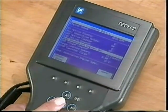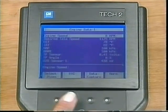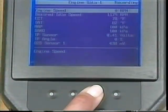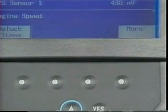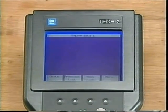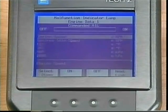To go an entire page forward or backward, use the arrow keys — the left arrow takes you back a page, and the right arrow moves you a page forward. Data Display also features several important soft keys. The DTC soft key takes you right into viewing related DTCs. The Data Capture soft key lets you take a snapshot while still in Data Display. Using the More key selects additional soft keys. Previous list and next list let you go from one data list to another. Within the tutorial for special functions, a sample MIL test lets you command the light on and off using the assigned soft keys.